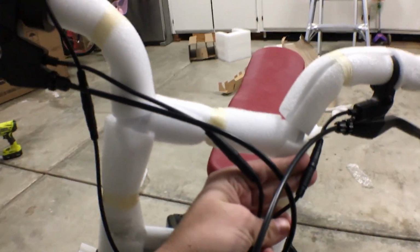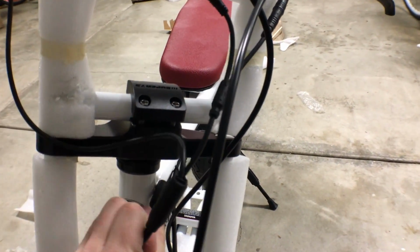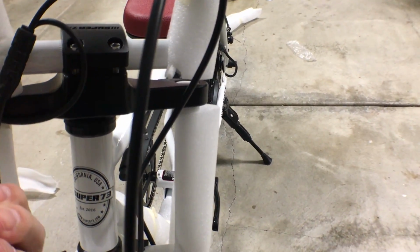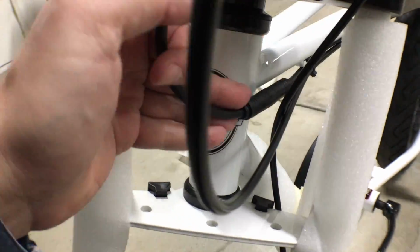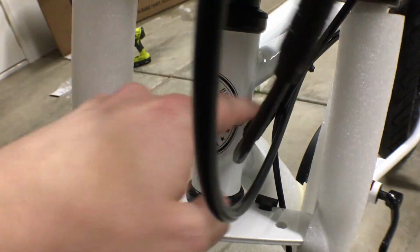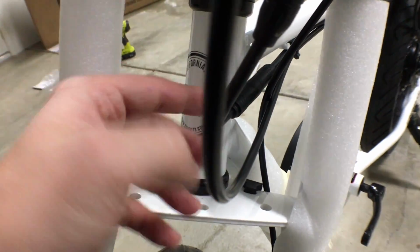So it looks like there's a disconnect for the motor. These wires here that come from the brakes are probably just a signal to say, hey, the user's yanking the brakes, so no point in applying torque to the motor. So let's plug that in. All right, so after bending one of the pins, because I came in at a funky angle trying to do this one-handed again, don't do this one-handed, use both. It's not keyed, it's just a cylinder and it slides in, so you need to line up the two arrows when you're plugging this thing in, otherwise you are going to bend pins.